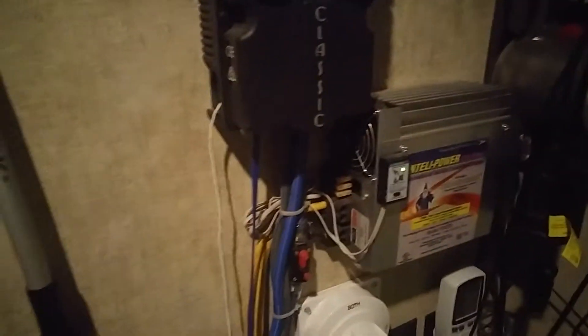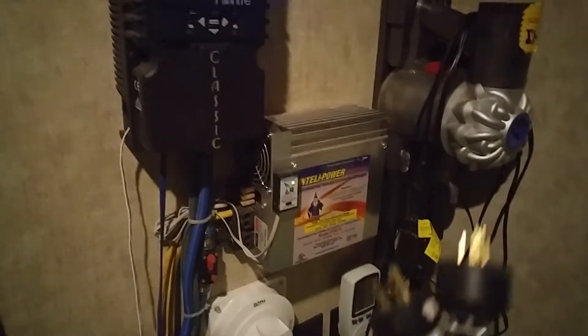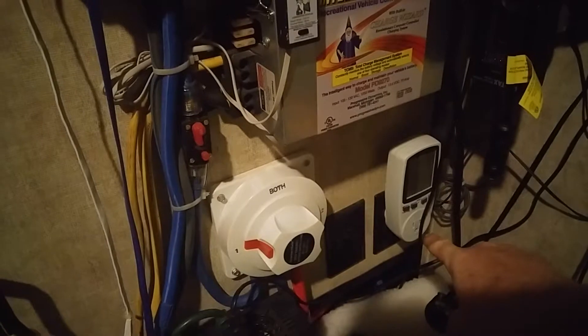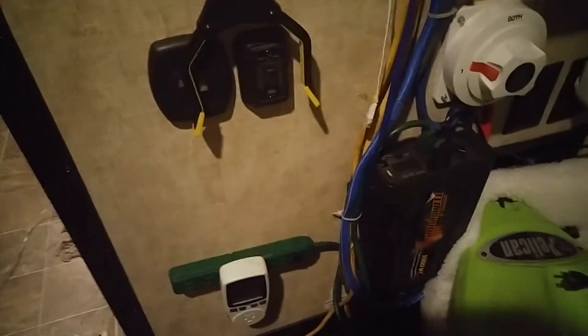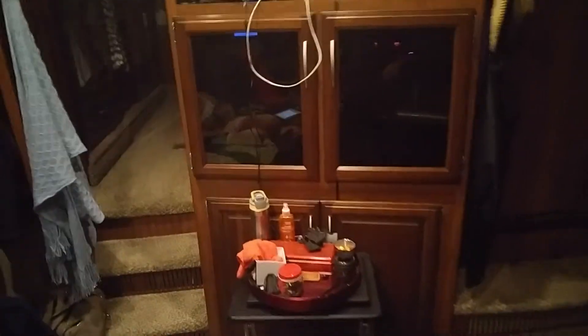What I do is I plug this cord — yes, it is two males — I plug one end into my outlet here with the kilowatt meter, and plug the other one into the power bar, then turn my inverter on. That's after I've killed all my breakers in the camper, except for the GFI ones.